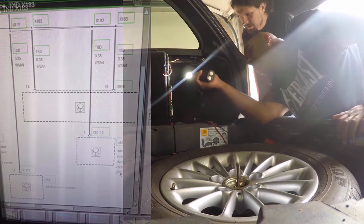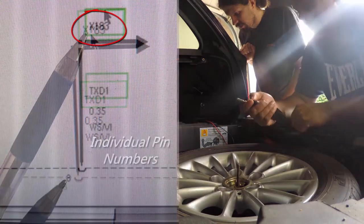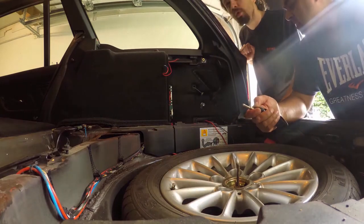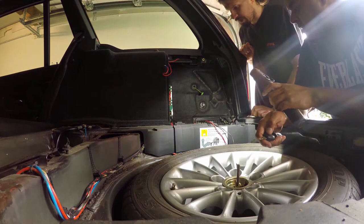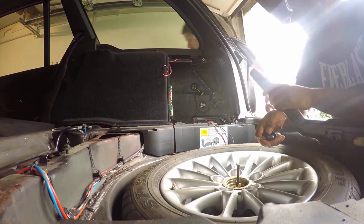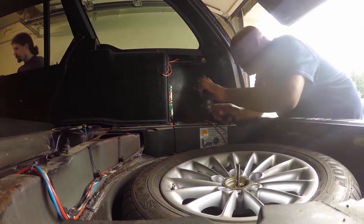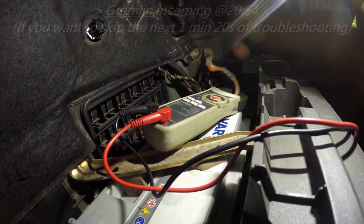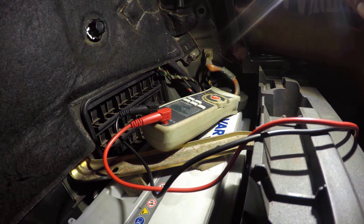And in conjunction with the process of elimination, we used the clamp meter to figure out where the current drain was coming from. Oh, 9 amps. But yeah, let's take this one off. We have 4.4 amps, 4.5, okay. So it's still drawing even with the car's... Which was probably due to the short circuit we were experiencing and the lack of communication with the airbag. So you're just taking one fuse out at a time? Okay, still the same. I'll tell you when something happens.